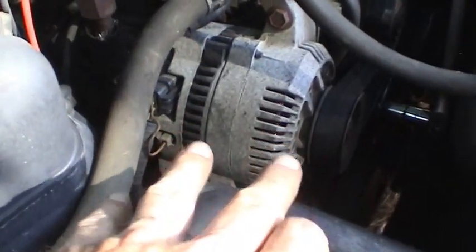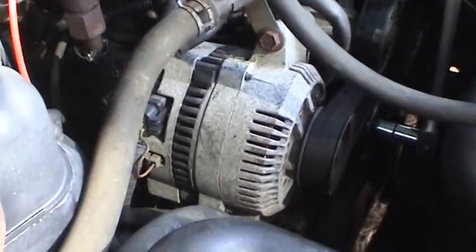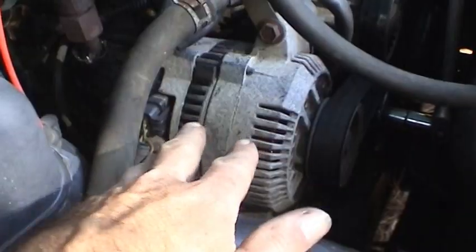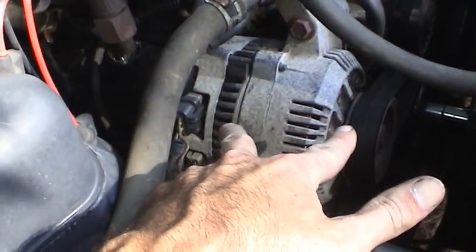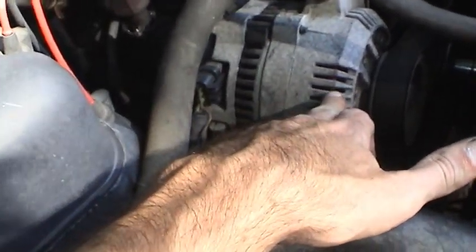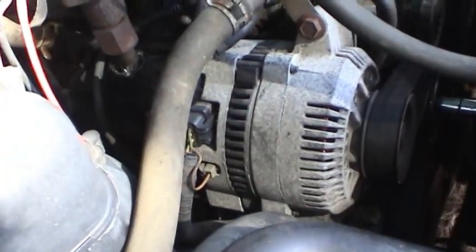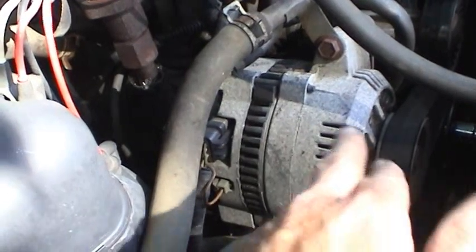The alternator is also fairly expensive, and it's better to go ahead and replace those parts that tend to wear out the most while you have the truck here where you can work on it in a controlled fashion, versus having the alternator fail on the road and leave you stranded. There's not much to go wrong with these things. You can have a bad regulator, bad front and rear bearings — which will let you know they're going bad well ahead of time — bad rectifiers, or a bad stator. But generally the stator and diodes really don't go bad. It's pretty much the brushes, because that's basically a wear item, a consumable item, and to a lesser degree the front and rear bearings.